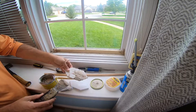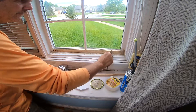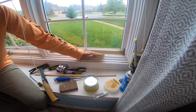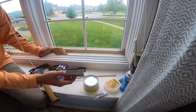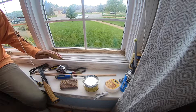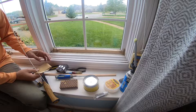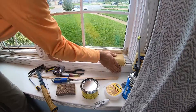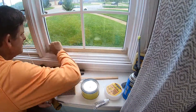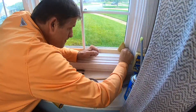It just sets up rock solid and very fast — 10 minutes, boy. Anything that you don't like at this point, you have to sand. I've got some 80 grit sandpaper I'll start with, and then we'll go down to probably a 120 sanding block, and then it'll be ready to prime and paint. Now one thing about this stuff — it stinks. I had this room closed off and oh, it smells like a body shop in here. So you definitely want to have some fresh air coming in.